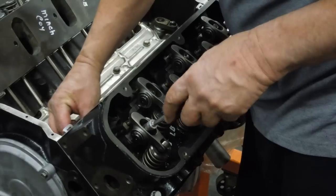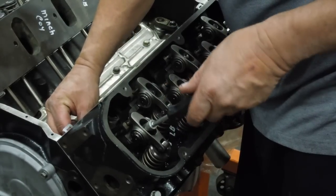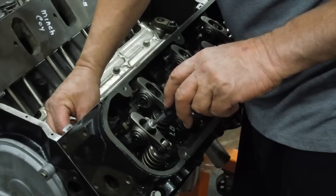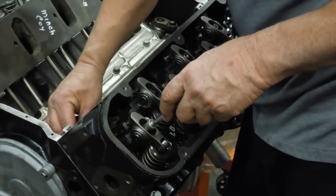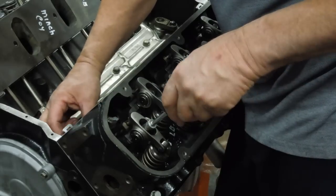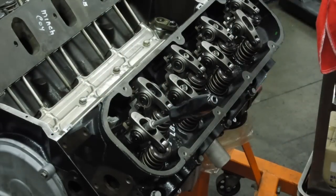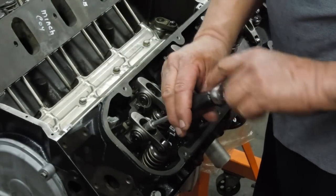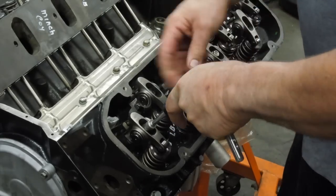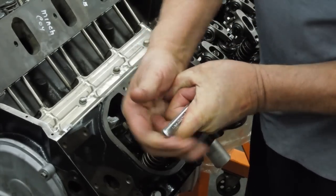See the push rod is real loose there, tight there. One turn. This one's one and a quarter. I noticed one was screwy because we had more than two turns and it wasn't down yet - I hadn't noticed that was on a cam lobe coming up. So this one, this one here, this one here, and this one here are the three we're not going to do until we rotate the engine over. See it's loose... got a little bit there... got none - okay, so we're at zero right there. One turn. One and a quarter.